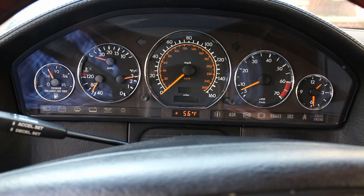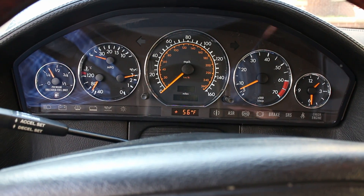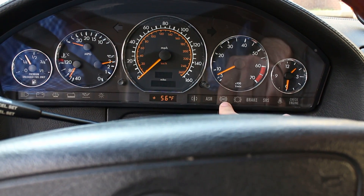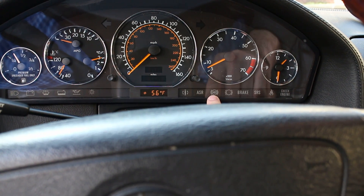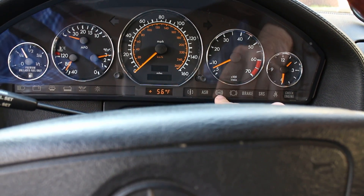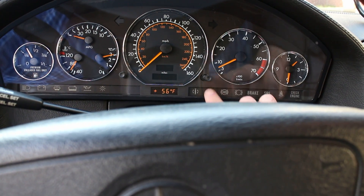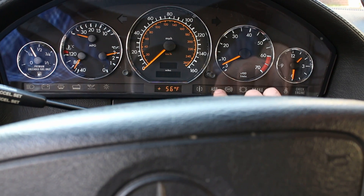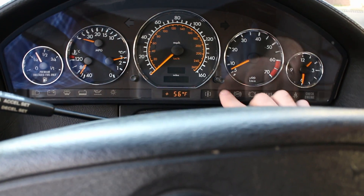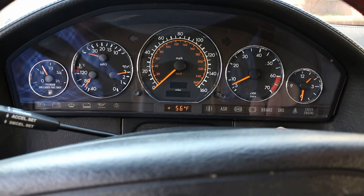This is basically limp mode in a couple of different scenarios: one throttle bad, second throttle bad, or both of them bad. In my case I only had the ASR light come on, but in some cases both lights come on — ASR and ABS together. It depends on the model year and model of the vehicle. If you're moving, like on a highway, then both lights might come on because ASR and ABS systems talk to each other — if one fails, the second one also does not work.